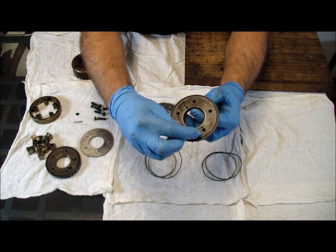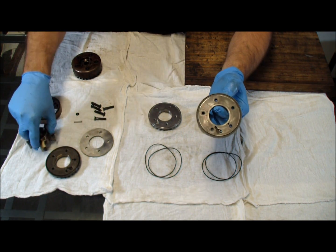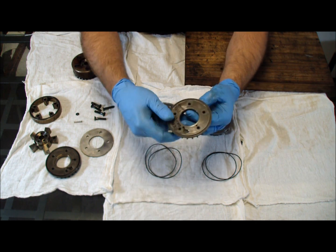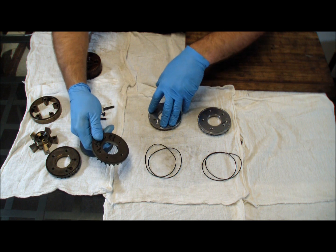This is not a big deal when it wallows out because the pin just sits down here instead of in the hole. The sprocket gets wallowed out by the pin, so we made our unit with a little bit harder metal, and it's all CNC machined here in the USA.